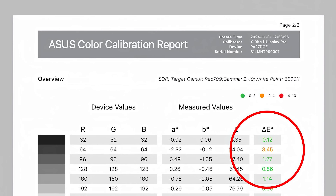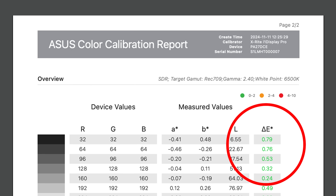There was one quirky thing with calibration worth sharing: every now and then, those darkest grayscale values just above black would come back with elevated Delta E values between 3 and 4. Running the same calibration again with identical settings brought those values back down. I tried looking at grayscale ramps and couldn't perceive any crushing. I've shared this with ASUS and they're going to check it out. But in general, the Delta E values were very good between 0.3 and 0.5.